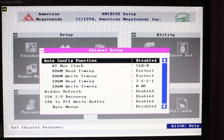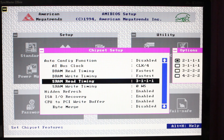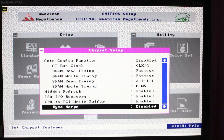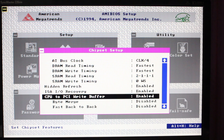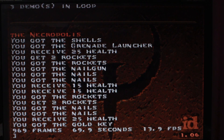It turns out the only memory or cache timing that wasn't already on the fastest setting was the cache timing. I'll set that down to 2-1-1-1, which should speed things up. That also explains why our DX4 100 was going so fast. I tried byte merge and fast back-to-back but they just slow things down, so I'll leave those off. I also tried turning the CPU-to-PCI write buffer off entirely and that slowed things down too, so I think we actually have the fastest possible BIOS settings. And yeah, that worked without any problems — 13.9 frames per second, which is not bad for stock frequencies with the AMD 5x86.